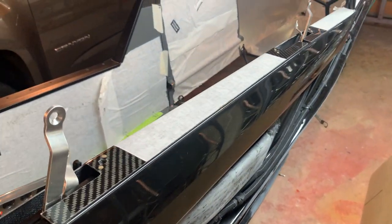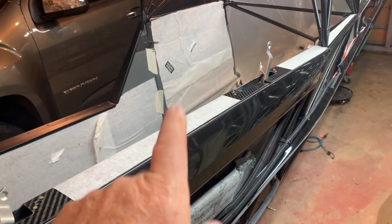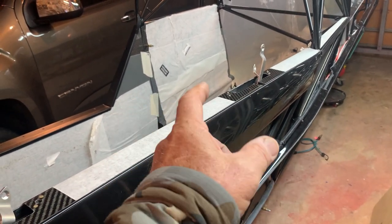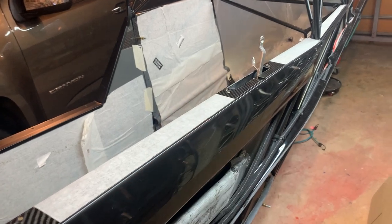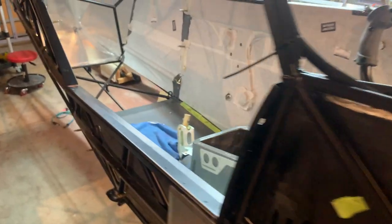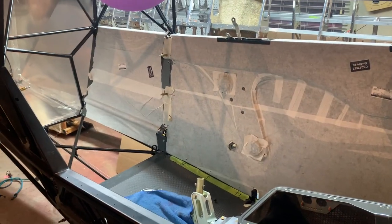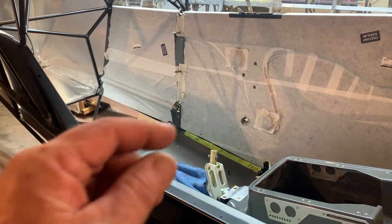So I look at what their idea is. If you want three going into one section, I'll make sure I put three in, but I'll just space them out nicely. It doesn't matter, you're just trying to secure it. Another thing that we do is these are drilled out with a number 10 drill bit. Those are actually designed to fit the plastic rivets that they use.